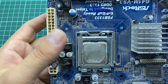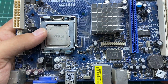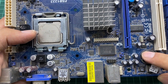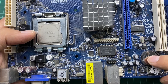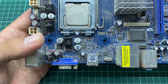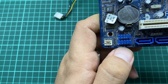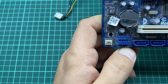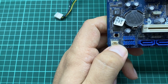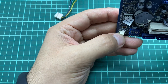These are the main components on our motherboard, and this is a quick look before we dive into the theoretical information. This is the CMOS battery — it's a battery that holds data we don't want to lose when the power goes off. There are also connectors for the power pins. Here we have USB connectors, so if you have a USB port on your case, you can connect the case USB connectors here. If you have an additional fan, you can connect it here using these two or three pins — again, follow the notch.